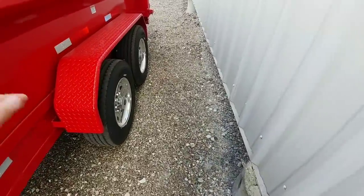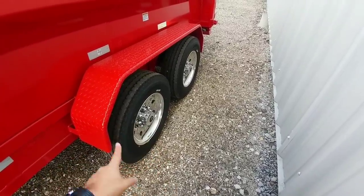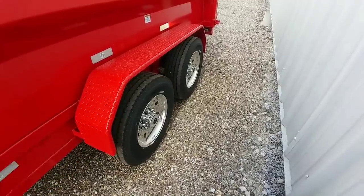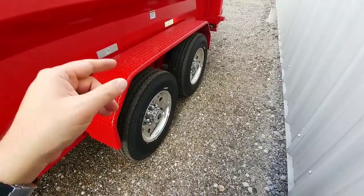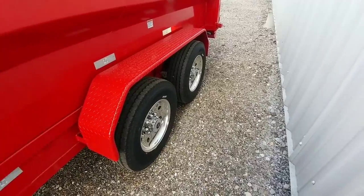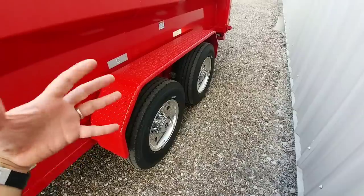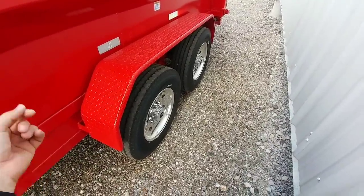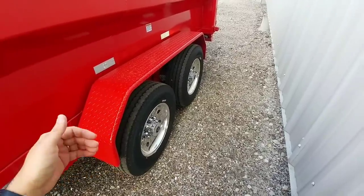Something else a lot of people don't think about: the hubs on this unit are not oil bath — they are greasable hubs with a grease zerk in the center. I can pop the cap off and grease my bearings through the center cap. A lot of people with these types of trailers prefer grease, and I actually had the option. The reason I went with greasable zerks as opposed to oil bath is that if you're hauling a heavy load and you have a leakage or a problem with a seal on the oil bath, that oil can leak out and get onto your brake drums, compromising your brakes. Grease, in my opinion, is a better system — it requires a little more maintenance but overall I think it's a safer bet.